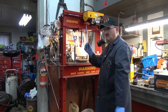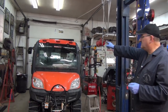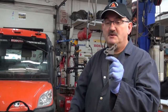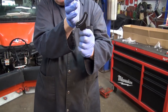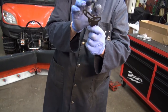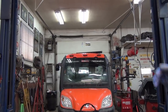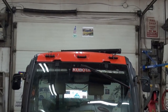Here we be — prime and paint installed. So I have the brackets painted, the middle one we redid. That's primed and painted. We have them back up in place and we're starting to put the mounting bracket up for the light bar now. They go that way, because that way the light can adjust down more if you need — whereas if you put it the other way, it can't adjust down. So just something to keep in mind. I have the light bar already laid up on top. These are designed for four mounting points, but I'm going to remove one because we only need three. That's going to be plenty of strength for that light bar.